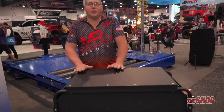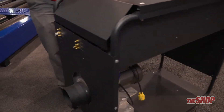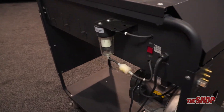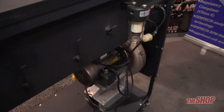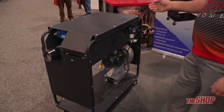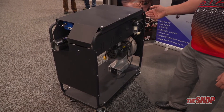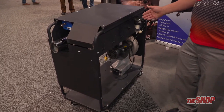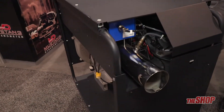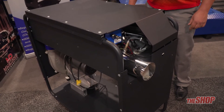This is another new product for Mustang Dynamometer — this is the V-Mass. This is a very important device for today's tuning shops and also aftermarket manufacturers that need to make sure they are compliant with the EPA. It has a built-in five-gas analyzer, AFR, and it also tells your particles per mile. It's very important to be able to show the EPA that you're compliant so that you can sell your products. This integrates right into the dynamometer software so you can print out the reports as well.